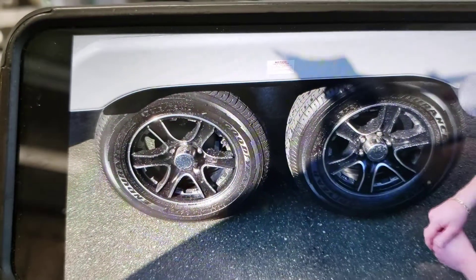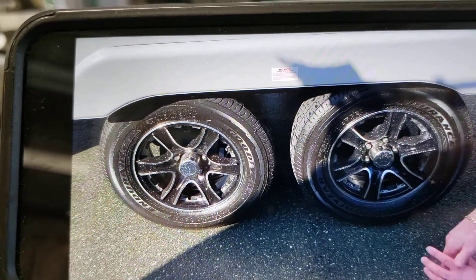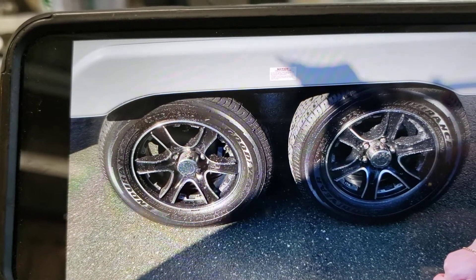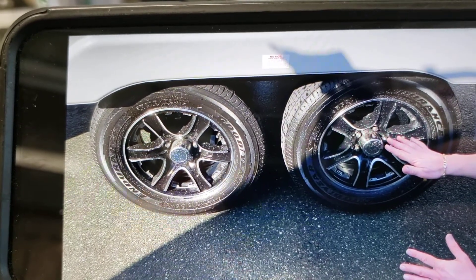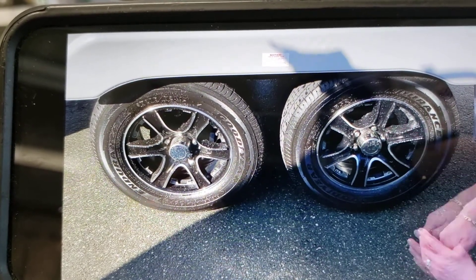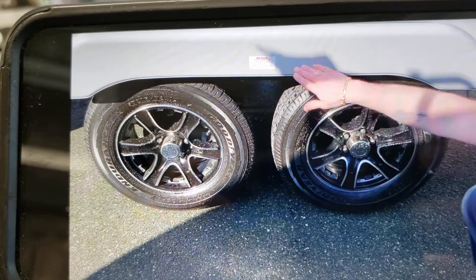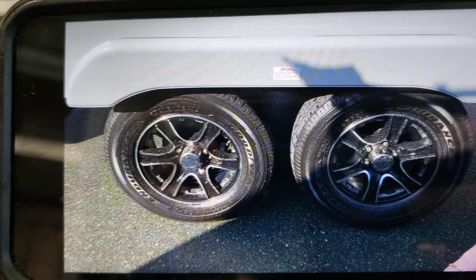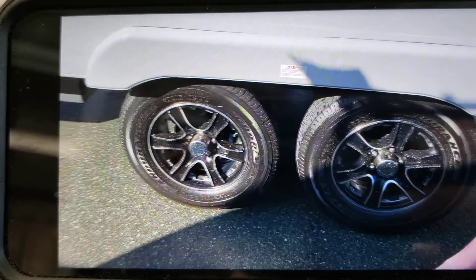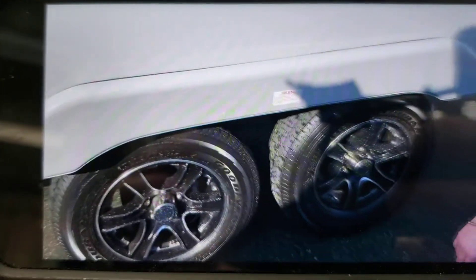Moving over to your tires — tire pressure should be kept to the maximum pressure on the tire, which in this case is 65 psi cold. Cold pressure means you check the tire inflation when the tires are cold, so you haven't been driving for a long time; you do it at the start of your journey. You should also check your wheel nuts before each trip. The trailer does not come with a wheel wrench, so go to your local tool shop and buy a torque wrench — typically torqued between 100 to 110 foot-pounds.